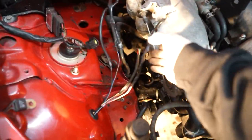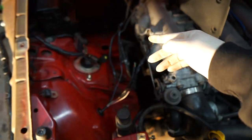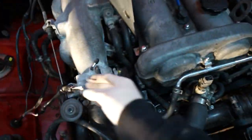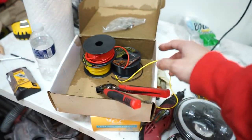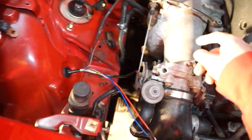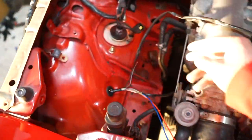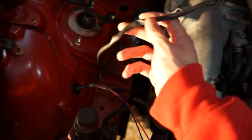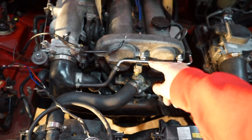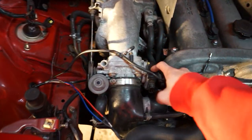You actually do have to extend some of the wires on the passenger side, because the motor wire won't reach all the way over. So I'm extending that wire as well as the harness. I've been working on extending these cables — I just extended this cable right here that leads to this sensor. I have a couple more wires to extend so they can reach the power steering, the thermostat, and the throttle body positioning sensor.